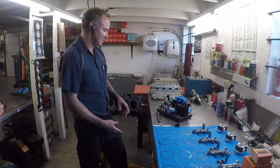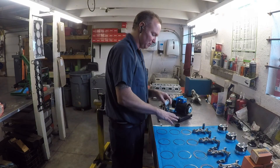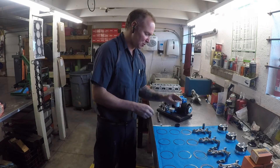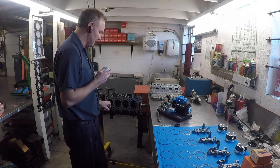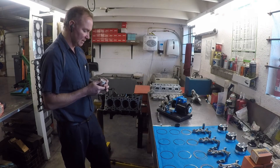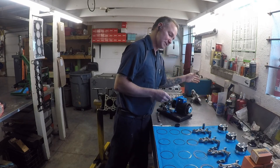I'm a big fan of Total Seal's product called Quick Seat — it's a dry assembly lube. Back in the old days they'd tell you to oil the cylinders down, and I've even seen guys dip whole pistons in buckets of oil before putting them in the bore. This dry assembly lube makes life so much easier. You have to make sure your bores are really clean — I use a combination of brake clean and a little penetrating oil — then rub the Quick Seat on your fingers and work it into the bores evenly. It's about $100 a bottle but it's an important part of making sure your Total Seal rings seal properly.